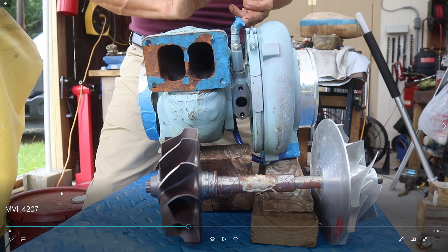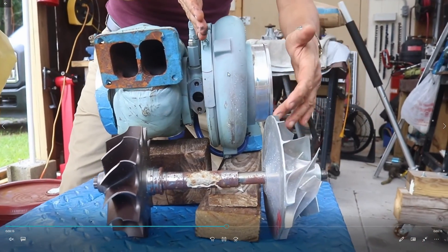If the seals are broken, oil passes through and comes out into the exhaust pipe. If the other seal is broken, oil passes to the cold side, and the fresh air suction picks up oil, causing air and oil at high pressure to enter the combustion chamber, producing blue smoke.